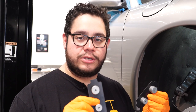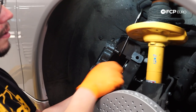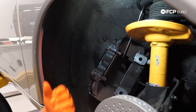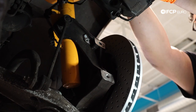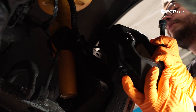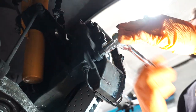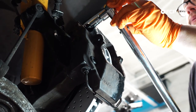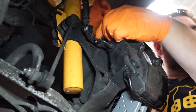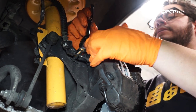Now that we have our rotor in place, we're ready to install our brake pad shims. They're very simple and pretty straightforward — these go into the bore of the piston, just like that, and same thing on the other side. Now we're going to grab our new carrier bolts and line the caliper up and get it installed. We're going to unhook our caliper — don't forget to remove that hook later. Line it up into place and take our new caliper carrier bolts, getting them started by hand. For these, you're going to need a T-55. Now that we have them snug by hand, torque them down to 63 foot-pounds. Now that the caliper's bolted up, put this 10-millimeter bolt back into the hard line bracket. If you want to torque this bolt down, it's going to be about 5 to 7 foot-pounds — we're just going to snug it in by hand.